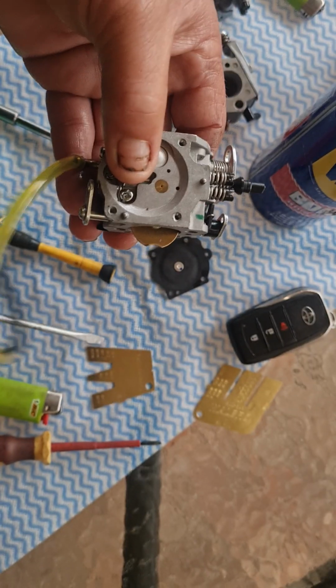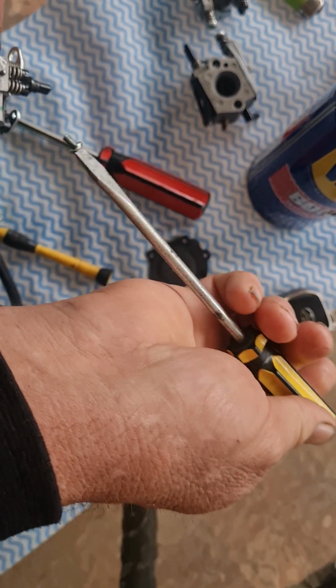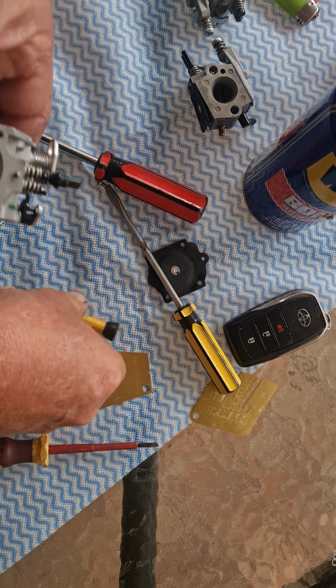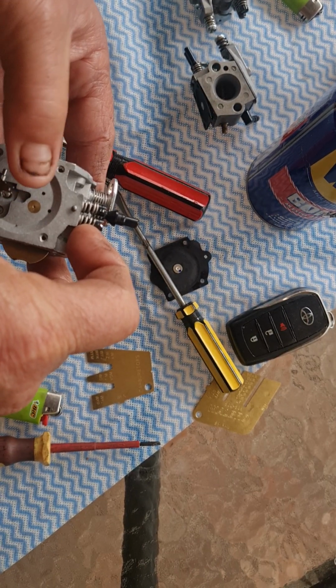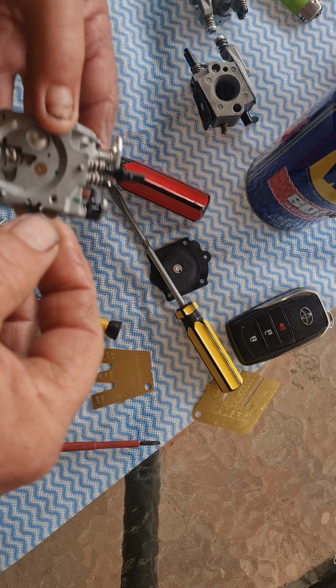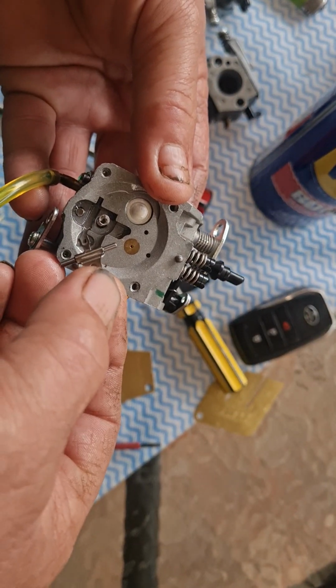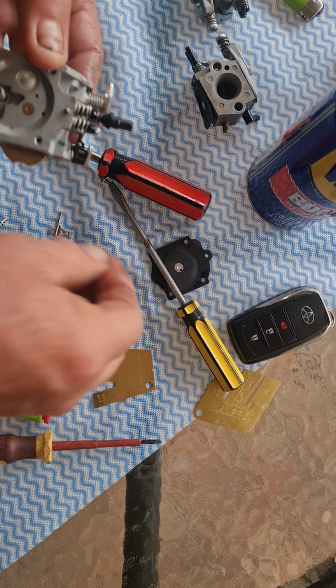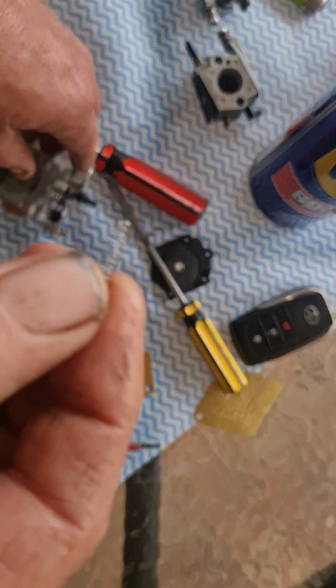Anyway, so I'm going to take the meter spring out. Make sure your screwdriver is sort of magnetic, it makes it easy to do the job, on these screws, plus putting the screw in. Now we're going to lift up slowly. Okay, there's your meter rod, and that holds your needle on the other side. Here's what they call a meter spring.